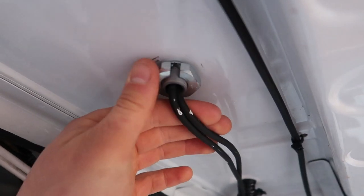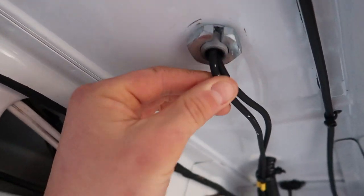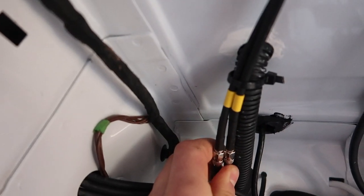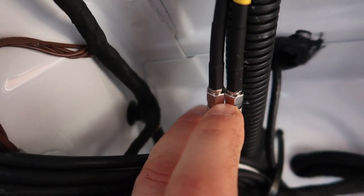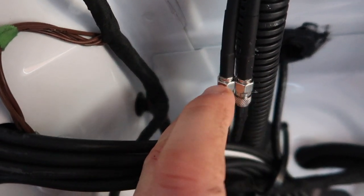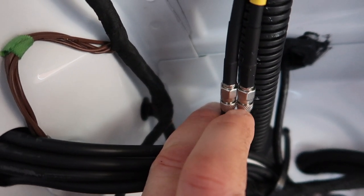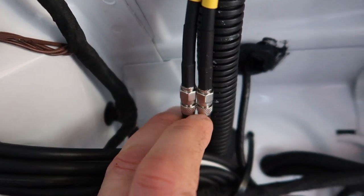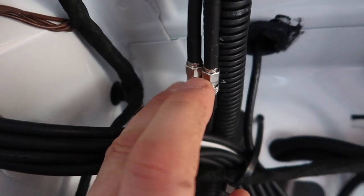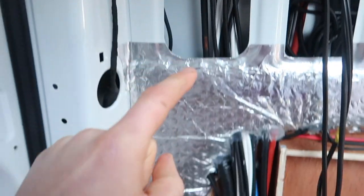So once you've got the antenna on the roof and the nut on the back, the cables that are already attached to the antenna, which run to here, this is what is on the end of them cables, one side of these lock nuts. This is the other side, which is on the end of the coaxial cables. These are the long cables that are supplied with the pack. So you want to screw these together,